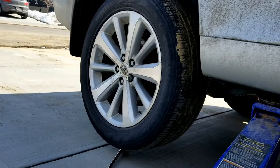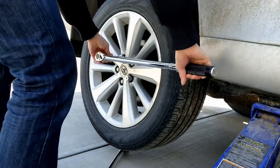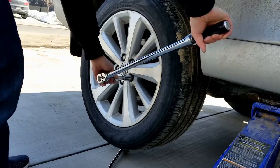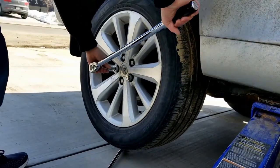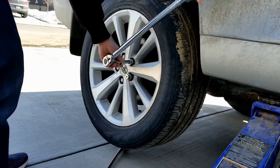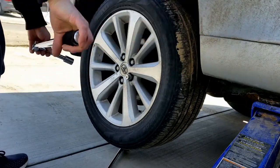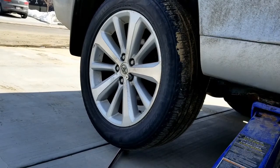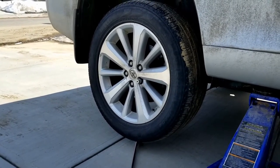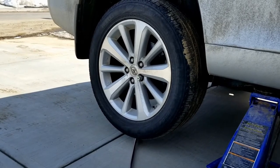Once you tighten, you'll notice there's a louder click. You'll also notice that I have my tire lifted off the ground — I did not want the bolts to have any tension, so this gives me a more accurate reading of the tightness of each wheel lug.